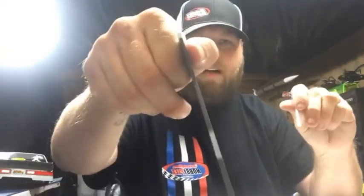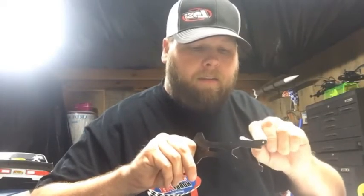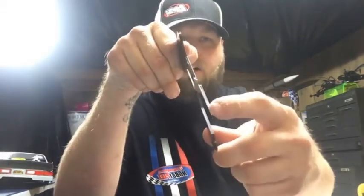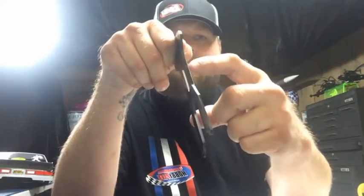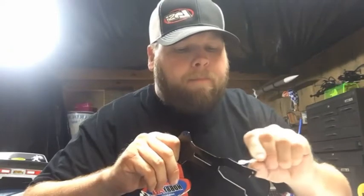You take that and you get the side of your carbon fiber here, and literally you're just going to go around the carbon fiber, covering it all with CA glue around the edge. Whenever your CA glue starts to run a little thin, put some more on there. You see how right here it's dull, but right here it gets shiny. Now you see I got a little speck there, but right here where it's shiny, you're actually sealing off the carbon fiber, and you're actually reinforcing it as well. You're making the carbon fiber tighter right there in that corner by sealing it off.